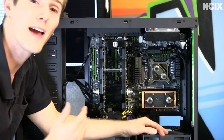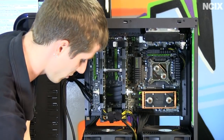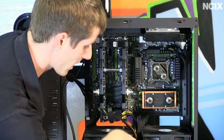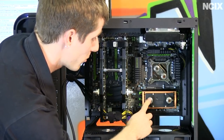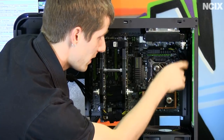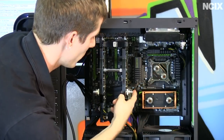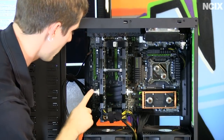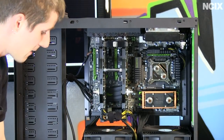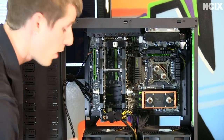The planned route: out of the pump in the basement, up through a gap into the RAM block, out of the RAM block into the top radiator, out of that rad into the first GPU inlet, out the outlet into the second GPU inlet, through the SLI fitting, and then bring that line down and plug it into our reservoir and pump.